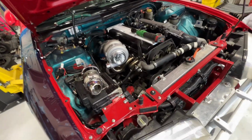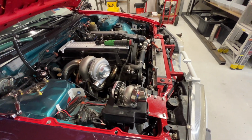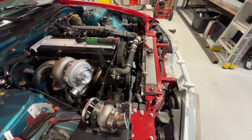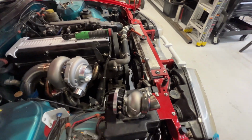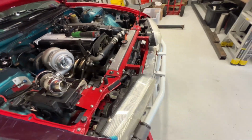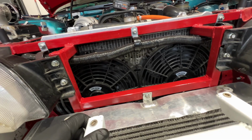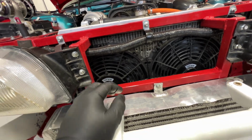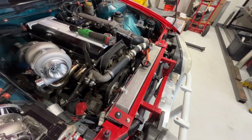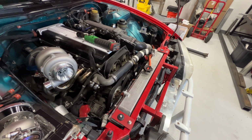And once that's all done, another thing that I didn't really talk about is the cooling system. This thing has some overheating issues, and they've tried a lot of things, putting some Mishimoto fans on, and they even experimented with putting fans in the front, but I think that's hurting them more than helping them, unfortunately. But I already went ahead and ordered a Koyo Enflow swap radiator for the S14.